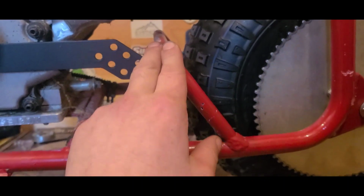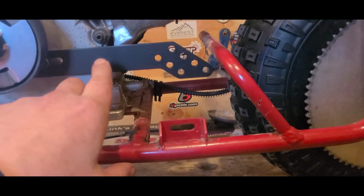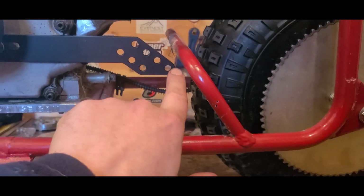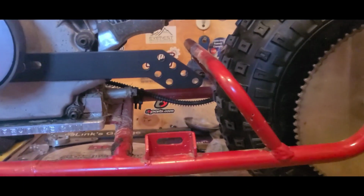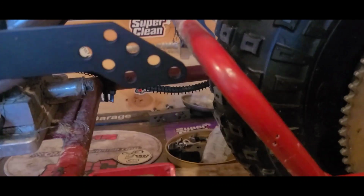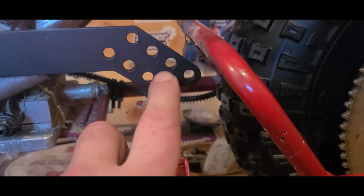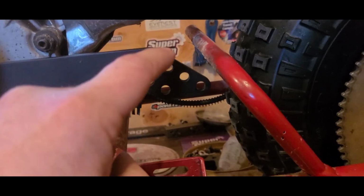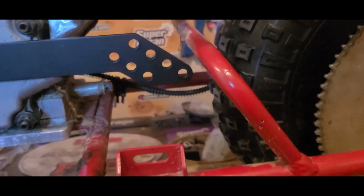Today we have this cross member as an obstacle. The chain is going to go over the idler. So if we picture it here coming up under our cross member over the idler, where are we going to be tight? Well, if we use this hole, we could actually probably hit the idler itself right off the frame. If we go up, the chain is going to go higher than the wheel itself, so it would be somewhere up here. And since we're using such a big sprocket, we'll end up hitting the bottom of this frame.